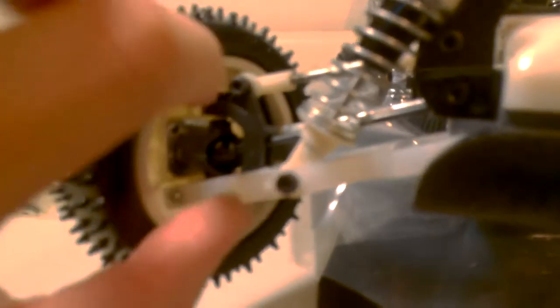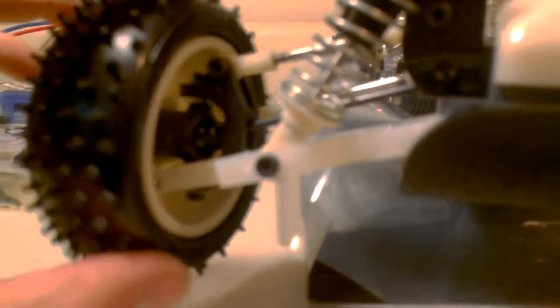So it's actually better to use kingpins, but because this is a 91, I wanted to try to stay true to the 91 as much as I could. I decided to stick with this kind of assembly here. And as you can see, there's a bit of play here vertically because those little spacers that go around the screw are actually too, well, I wouldn't say they're too long. Maybe you can argue that the caster block itself offers too much space for the knuckle to move around. But that's easy to fix.